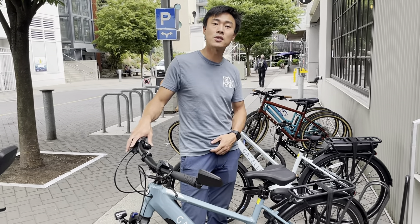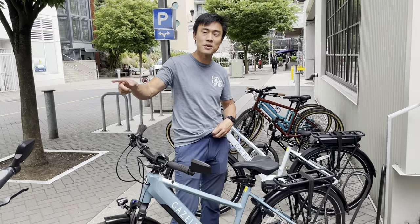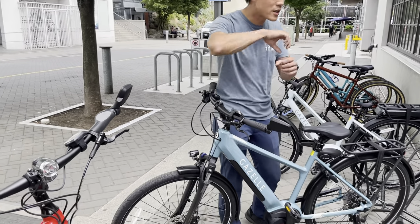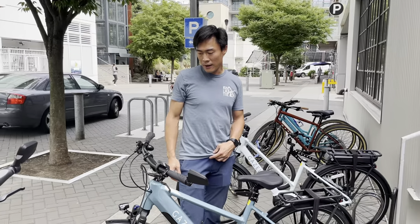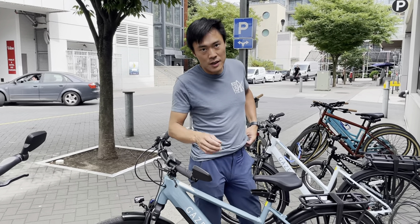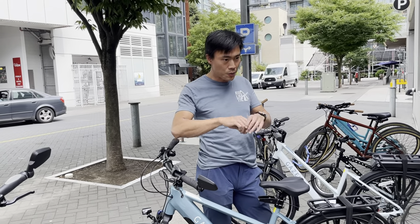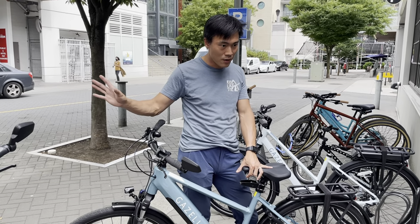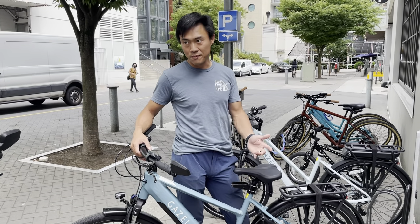Most flat tire repairs that come to the shop happen because people don't pump their tires — it's preventable, so pump your tires. Even the rear tube you have back there still needs to be pumped. If you don't pump it you'll get a pinch flat from inside, and that's frustrating because it's puncture resistant. Your original tire also comes with an additional layer — a cap-like insert — making it even more puncture resistant, deflecting most punctures. Track your tire pressure initially once a month, then maybe every other week.